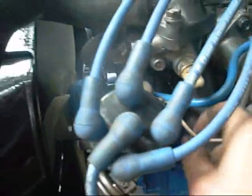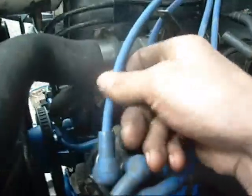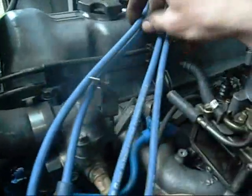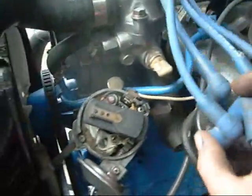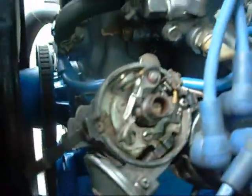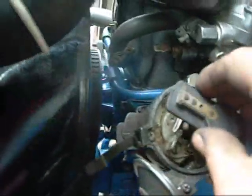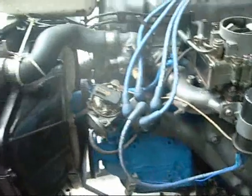I might do a condenser, which may cause it to fire way off. I'll look at the coil — it's getting a little bit warm there. Everything is a bit tired; the leads have rubbed in places. The cap's had a recent replacement and the rotor button is acceptable. Just a matter of cleaning it up, doing the points gap — points gap, condenser, and coil might make a bit of a difference.